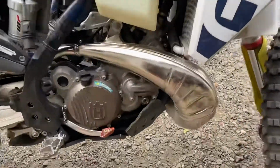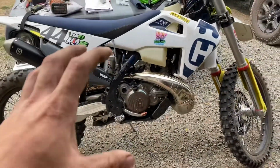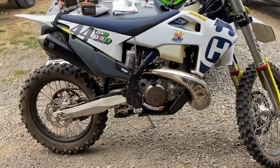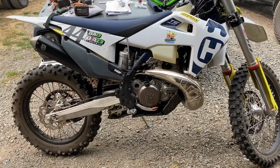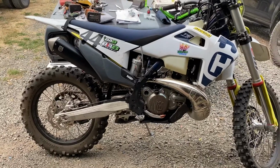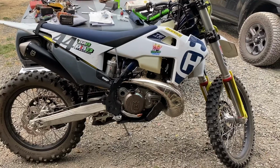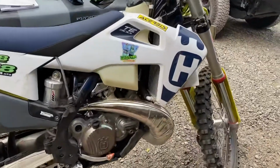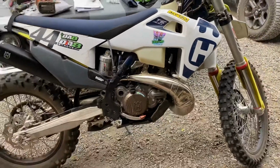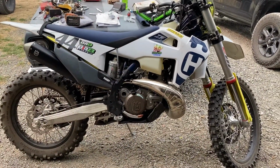I just tuned the power valve a tiny bit and got the AFR right to what the pros in pro racing cars and pro racing trucks want, their perfect AFR for the bike, and got it rich. My bike, as you can see, doesn't run a fan yet. That's because my bike's not overheating, because it's not lean anymore. I'm running it richer at 13.5 to 1.